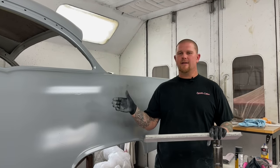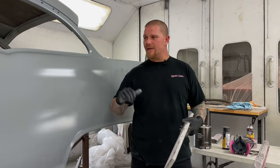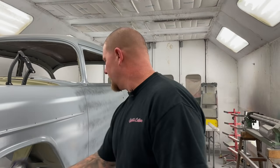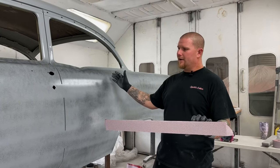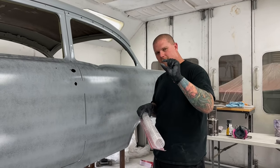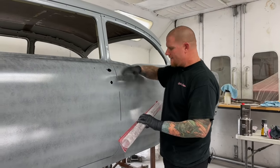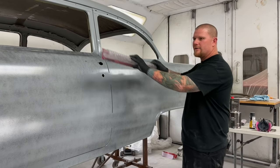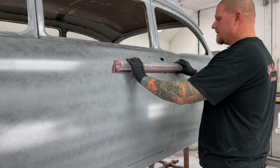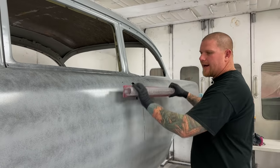Next we're going to talk about the finesse it takes to create these perfect shapes. We're going to guide coat the car with the aerosol and we will come back and pick 120 grit on the block and start from there. All right, so we have the car guide coated with an aerosol guide coat and we now have 120 grit on our linear blocking tools. The linear blocking tools are just a skosh narrower than the other blocks, and the reason that's good is when you're rolling into areas that might have a roll — maybe you're in a fender lip — you can use that sandpaper over the edge to very carefully create the shape that you want. So you want the block even, evenly spaced, light pressure, and you want to block this car in a 30-to-40 to 45-degree X pattern if you can.